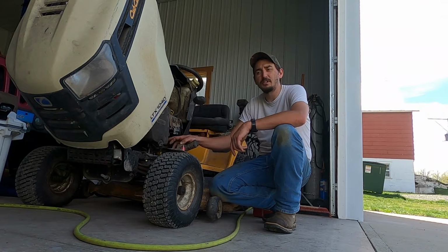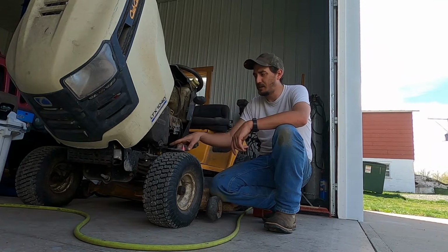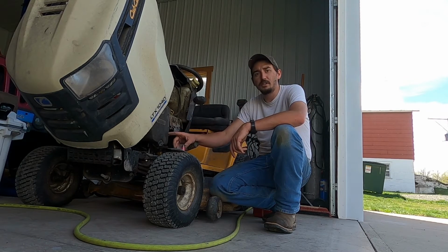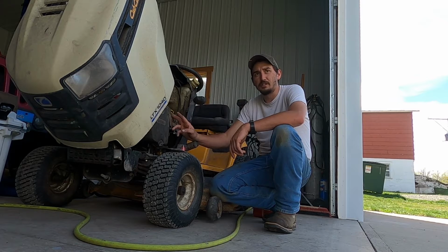And the reason I'm doing this is I've noticed that the fuel tank itself seems to have been losing some fuel. And I think it's going into the crankcase, which means the needle in the carb is getting a little weak. You can rebuild the carb to fix it, but on this old of a machine, it's kind of my backup and I'm just not being bothered with it.